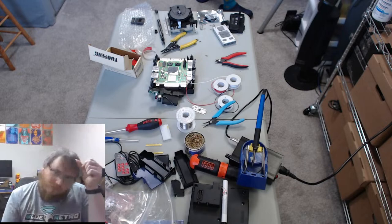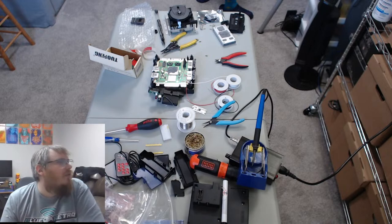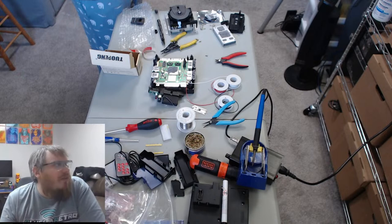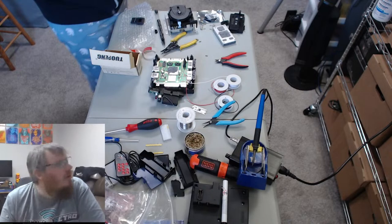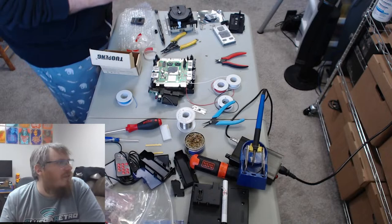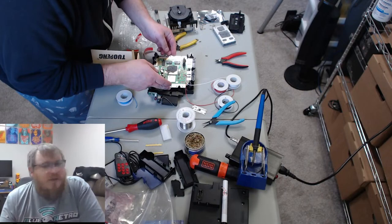What else we got next? It's blue and orange. So that's for the MX chip. Okay. It's blue, and I guess I'm going to have to use yellow instead of orange, but that's fine. So the side with the CPU, go 3 over. Is it the same side of the motherboard or is it on the opposite side? So it would be the side of the MX chip next to the CPU or GPU or whichever chip that is. Man. Oh, I see it now.